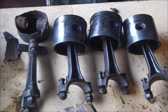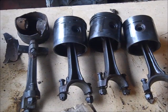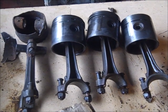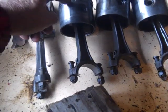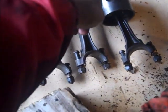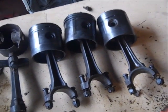Good morning. I got them pistons cleaned up a little. Looks like I gotta buy a new piston. I think I can get by with just two sets of rings, but we'll see what they cost — I might just get all new rings. These two center ones, the rings are loose, but the oil rings are a little snug.